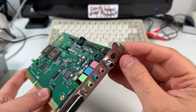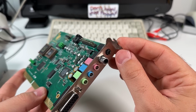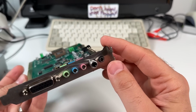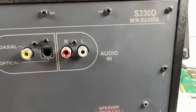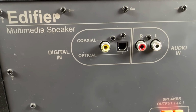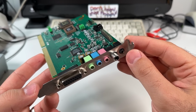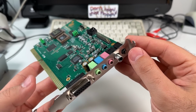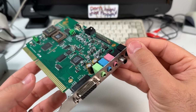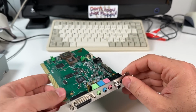Another great feature of the Orpheus 2LT is one that you won't find on the majority of vintage sound cards: digital audio out. So being able to completely bypass the analog output section of the card and interface with external DACs or capture devices could be a very useful feature for those really serious about audio. The SPDIF output can be configured to include all audio sources too, both internal and externally connected, which is great. Some vintage cards with SPDIF output only output some of the audio sources, so maybe missing things like FM music or CD audio, for example.